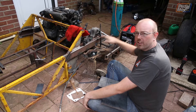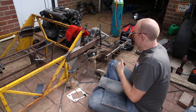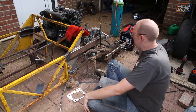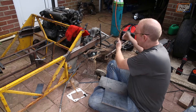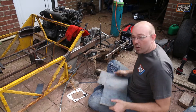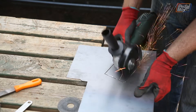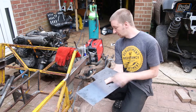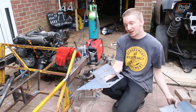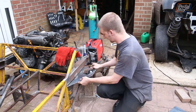Because we have a one-piece hub and trailing arm, the position of this chassis mount dictates what toe we have on the drive. We need to keep this parallel because we want the wheels on the back going straight ahead — they're not steering because we're not insane. That means we've had to make this jig up so that we can hold this parallel to the chassis leg and work out where this needs to mount relative to the chassis leg onto this plate. So this is a rough cut of our trailing arm mounting plate — it's going to live on the side of the car here. We've done a bit more tidying up to make it look a bit pretty, and it fits in just like this.